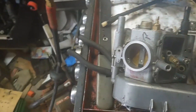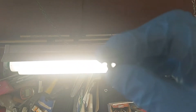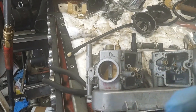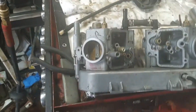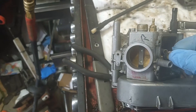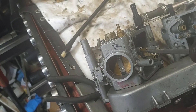Got that jet in there, just cinch it down with a flat screwdriver. The pilot jet has a very, very small hole through it. The easiest way to clean it is to take a piece of electrical wire, strip the insulation off, and pull one strand of wire out to stick through this hole - that works. That pilot jet goes into this hole here, tighten it down with a flat screwdriver as well.